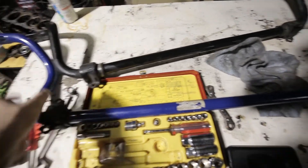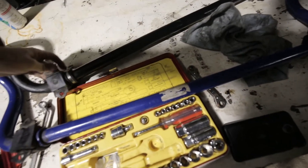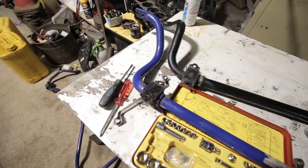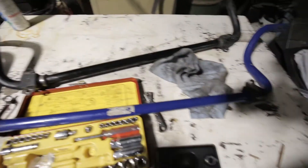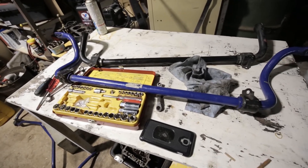Got more solid bushings as well, instead of the old crapped out rubber bushings — split bushings, which are swollen and not great. New bushings, new sway bar and links. It'll still improve handling by quite a bit. Alright, let's chuck it in.